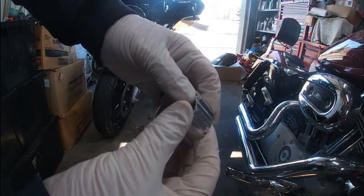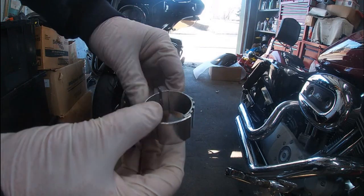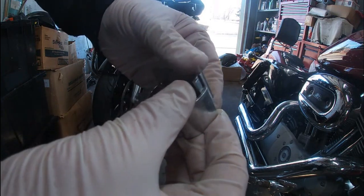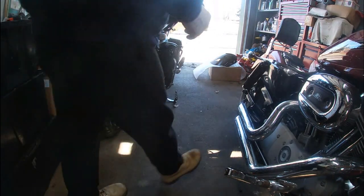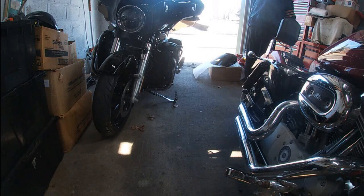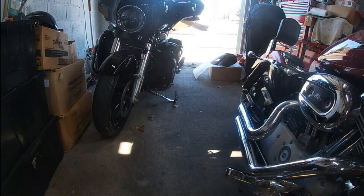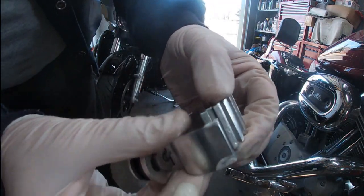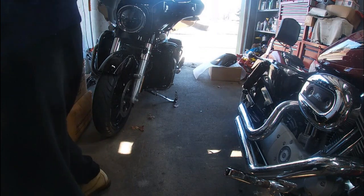Another thing I found is these clamps. Okay, these are actually what goes around the fork. This goes to the outside, okay? And the way they slide together and clamp down. Problem is, this metal, I've already put some oil on there to make them come apart, but when you first get it, it's going to be extremely tight. So I'm about to add a little bit of white lithium grease to it, and I'm hoping that that's going to work a little better than what it is, throttle cable, clutch oil from Harley that I put on there. So I'm just going to put a dab of the lithium grease and hope that makes them move easier, because, you know, once you get it in place, it's a pain in the butt. So, see, that's sliding nice now. So I got to do that with all four to make it easier for assembly. So I have one that's still extremely tight.